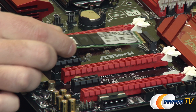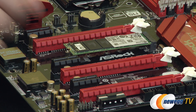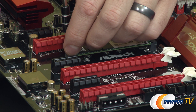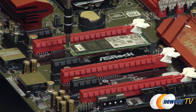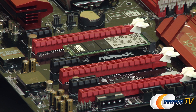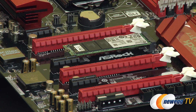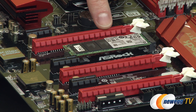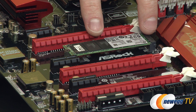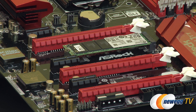The SSD is fairly easy to install — you just pop it in, push it to the side, it drops into the slot, and then you secure it with the screw. I do want to mention that you have a couple of different ways this slot can be wired up, and it can be wired for Serial ATA. Since the M6E is specifically PCI Express, make sure that if you're dropping it into a desktop or laptop with an M.2 slot, it is wired for PCI Express — at least x2 Gen 2 — so you have enough bandwidth to take advantage of the SSD's speed.